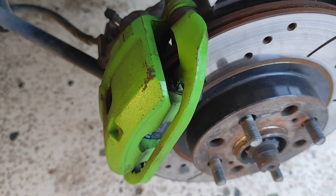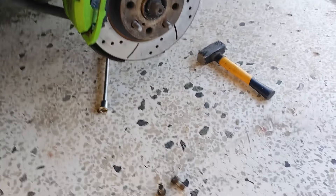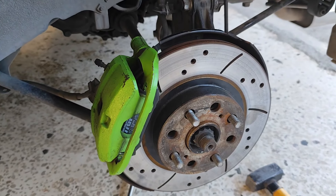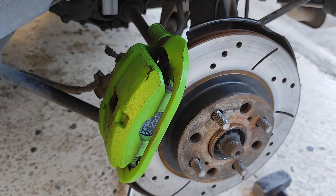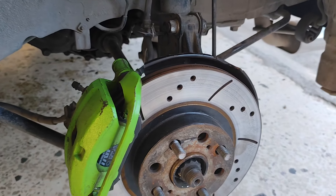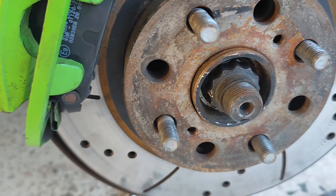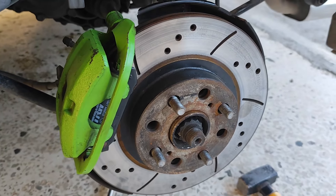Then we will be able to remove the brake pads and completely take the brake rotor off. One thing to do when you get to that point — by removing the two bolts from behind — is to take off the handbrake, which I forgot. So I'll have to go get my keys, open the door and release the handbrake, because obviously it's stuck on the brake rotor. If the rotor is corroded and stuck, you can always put two bolts in these two areas, tighten them up and the brake rotor will come right up.